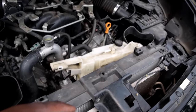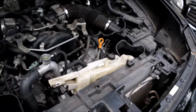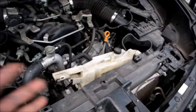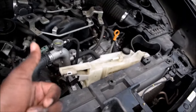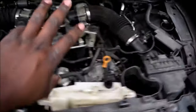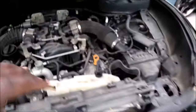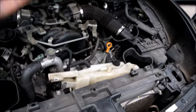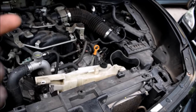So I'm going to add some coolant here. This is not final per se — when I come back to do it 100% properly, I will get a brand new radiator cap — that's the one thing I'll do. Two, I'm going to flush the entire system. And three, see that plastic bit over there? I would replace it with a metal one. Those are things I'll address in a future video. For now, I just wanted to show you the troubleshooting sequence whenever you have sloshing sounds under your dashboard when you start the car.